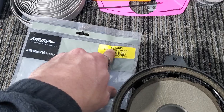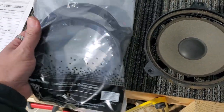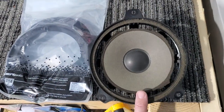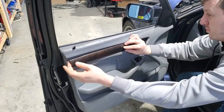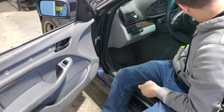We're going to use the 829303 rear adapter plate. Used to have to make these back in the day, but thank god somebody started making these. Now we can put the speakers in here and replace these. This is an E46 sedan, not a coupe, so there's a big difference. You pull that trim off just like Jimmy did right there.